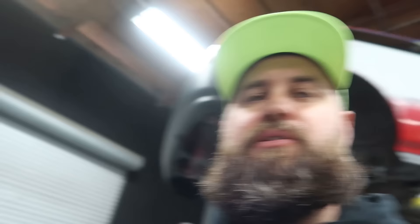Our headliner is free now. One thing I've learned in the past is you want to be pretty delicate with this, because it's a foam-back material but it has a cardboard material that makes it stiff, and if you bend it too much you actually crease that. Getting the creases out of the cardboard piece is really difficult and you could ruin the headliner, so you want to bring it out as easily as possible. We have a hatchback, so I think the best way to pull this out is straight back out through the hatch.